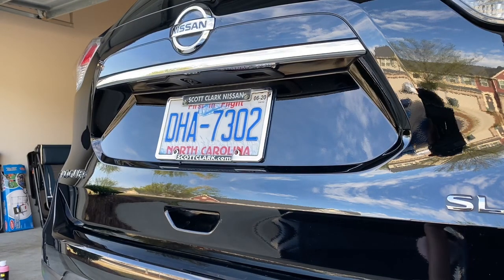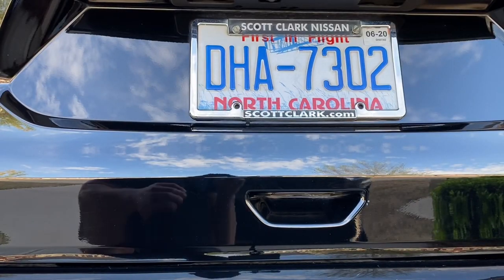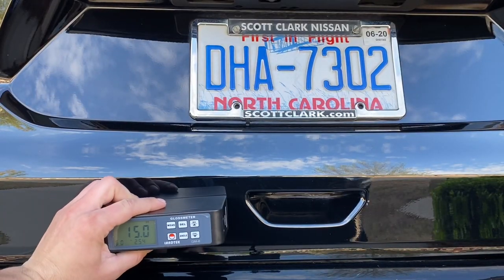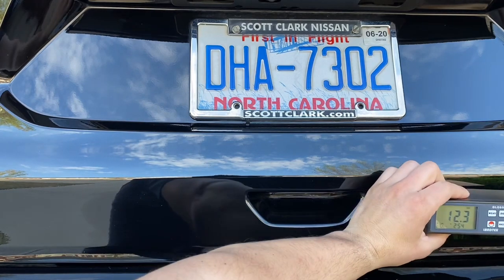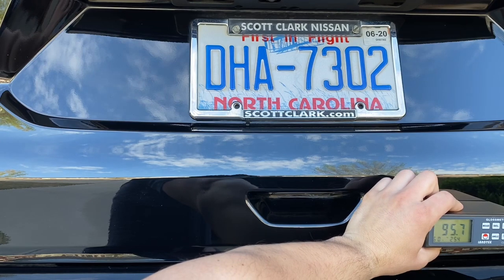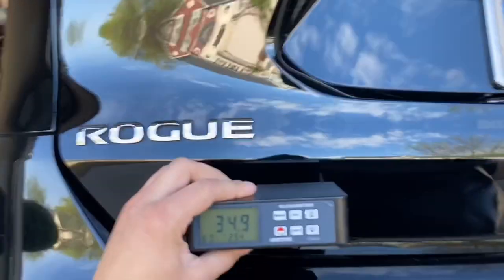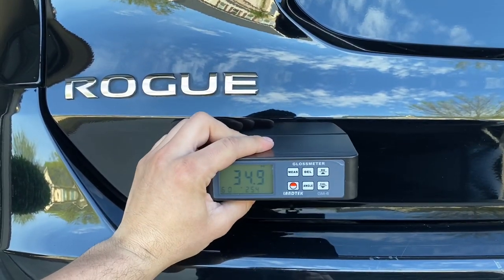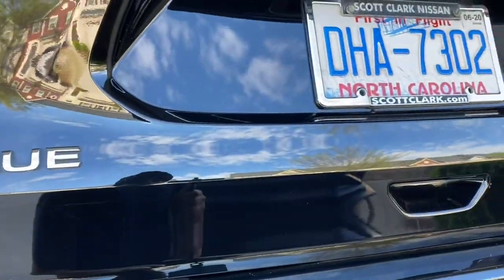I don't know how you guys can tell from the camera, but let's take a gloss reading. Yeah, that's a little better. All right, down here. 96.9, and on this side, if I can find a flat spot, 95.7. Let's take one right here. 97.7. Okay.